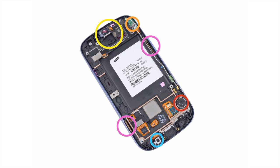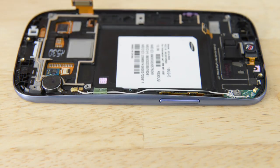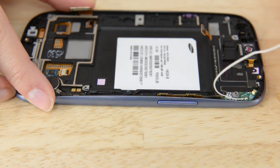If you're replacing this with a brand new front panel assembly, be aware you may need to transfer some parts, including the vibrator, antenna, front camera, earpiece sensor, microphone gasket, and a few buttons. To start, you're going to peel the antenna cable from the channel, but make sure not to disconnect the cable from the board at the top. Now you can run your spudger under the ribbon cable to continue peeling it from the front panel assembly.